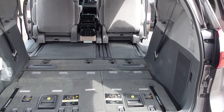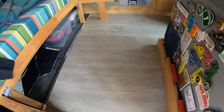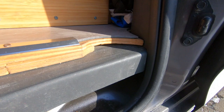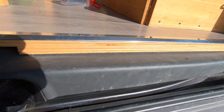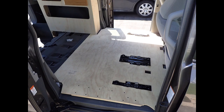Shimming. Unfortunately, the floor of a minivan is usually not flat. After putting in place my new plywood floor, I walked on it to find any spots not supported that were creating undesired movement. My focus was particularly in areas where I was going to put more pressure and full body weight — mainly the door entrance. This is where you lift yourself into the van with your full weight on a single foot, very often. I simply filled up the empty spaces between the plywood and the floor of the van with the right thickness of plywood. I added pieces until the floor was not flexing anymore. Then I screwed those pieces to the main plywood floor. That's it!